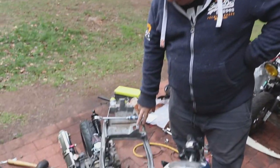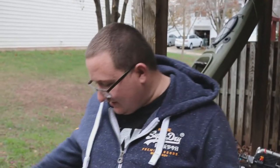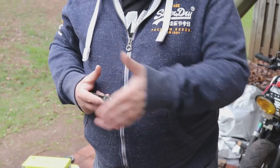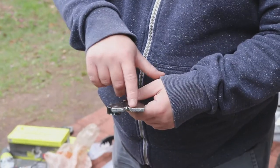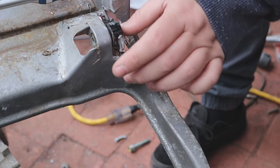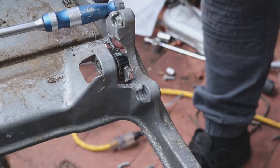We are trying to get a little bit more space out of this. I also went ahead and ground down the face of this so that it was considerably more narrow — that way I can actually fit it up into this space. The only problem is we've got to whack out some of this part of the tower and also down in here, so that there's a little bit more mobility for it to move back and forth as it's going to need to with the suspension. We have cut our big hole for the actual swinging trailing arm thing for the shock to bolt to. We've now got that moved up. We went ahead and made a couple of edits — we chopped a big chunk of it off here because unlike the Ruckus frame, this section does need a lot of editing. We also added a triangular notch so that it will sit flush and rock in this space. That triangle cut now allows it to mate a little bit more securely up against the chassis. I'm going to get some spray paint on there just to seal off the metal so it doesn't rust.